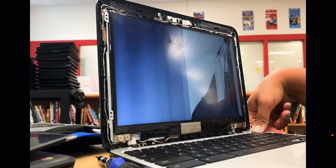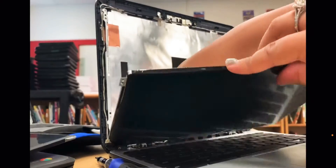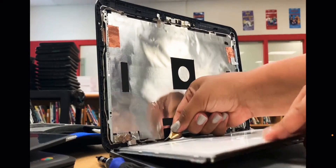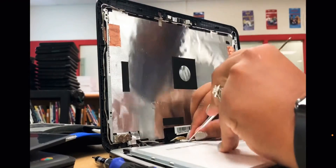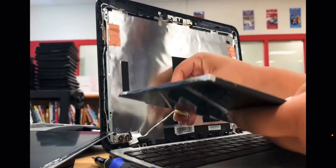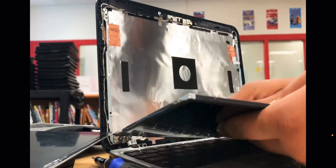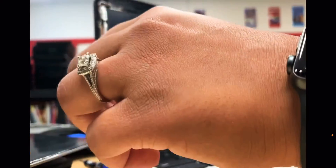After you take those screws out, make sure that you have your computer turned off. After you pull out the screen, you'll notice that on the back there is a little gold plate with teeth. You are going to slide that out, then grab your next screen, and with the gold teeth, slide it right back in and connect your screen.